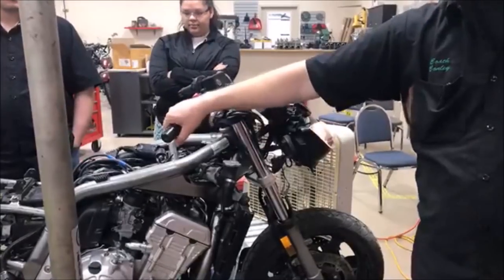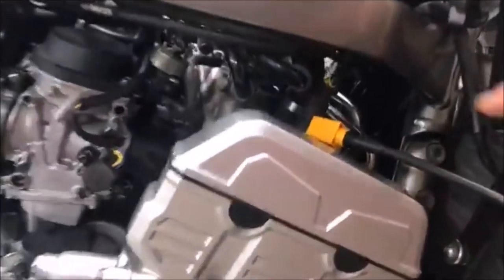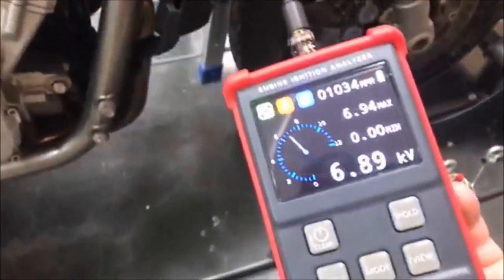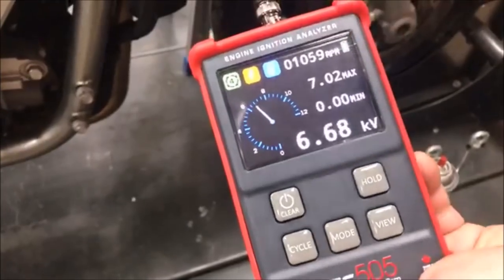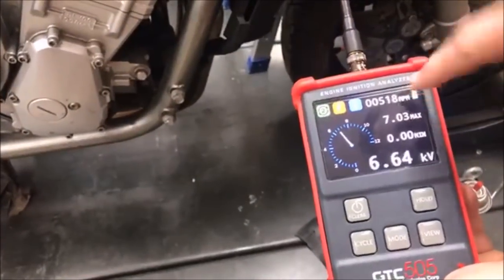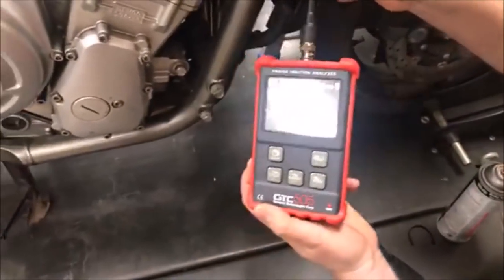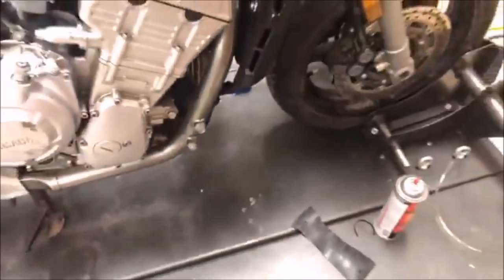Let's use it on a bike. You want to make sure that you don't go around the cap itself — you want to go around the wire, not the insulated part. Go ahead and look at the tool. How cool is that? We're getting secondary voltage right now. It's peak, but we're also getting RPM. Look at the gauge here to see how accurate that is — pretty consistent. If I were to switch this to two-cycle, you'll see that it'll be wrong — you can see it cut in half there. Now here's where the speed is. Boom — there's wire number two. It's literally just that fast. That thing's pretty stinking cool.